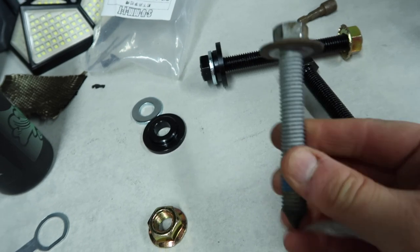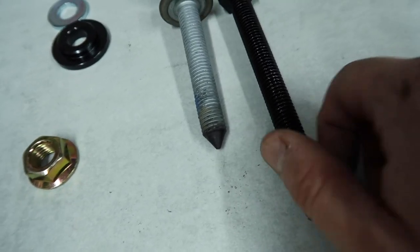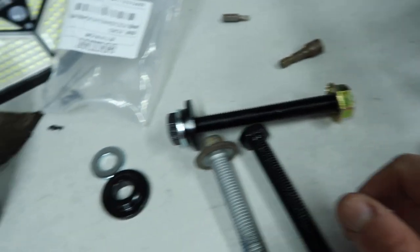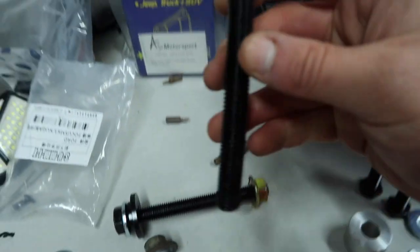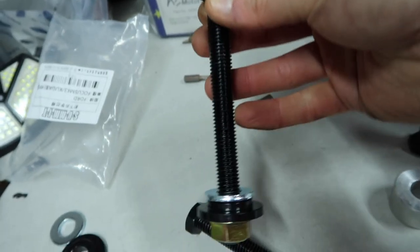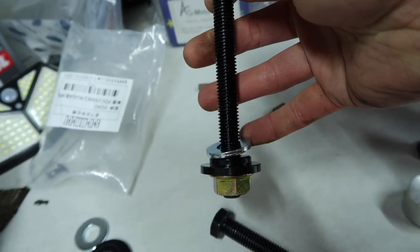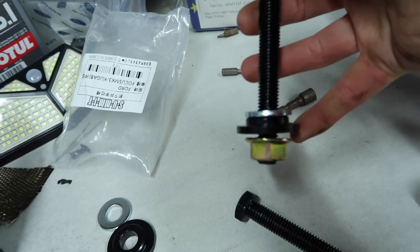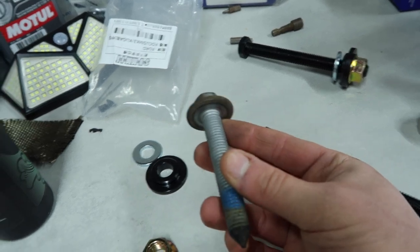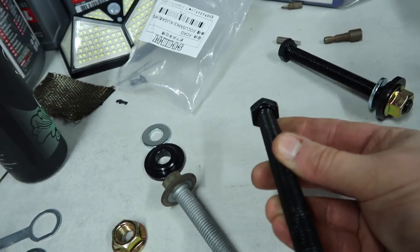Here we are then, out of the car. Might as well show you a side-by-side comparison. This is, of course, the bolt that we just removed — the big boy. This is what we are replacing it with. Set them side by side and you can see we get this extra length that we need to then attach our new brace plus the nut on the bottom. Now, whenever we put this in, Summit suggest you put the big bolt down through and then on the other end use a washer, this sort of black spacer thing that's going to cap that hole in the subframe, and then the nut. One thing I've noticed is that the stock bolt has this big built-in washer type of thing, whereas we don't really have that kind of surface area on our replacement.